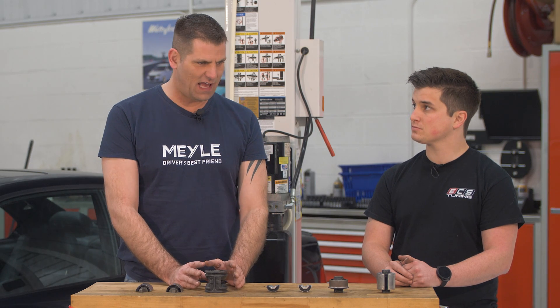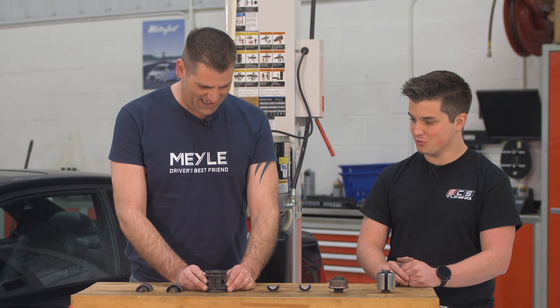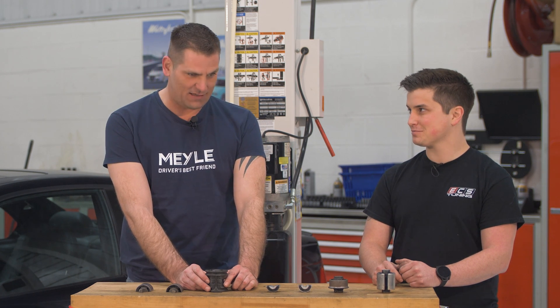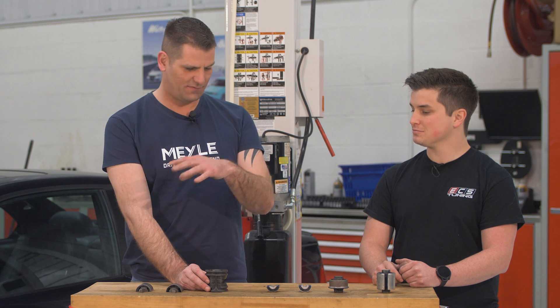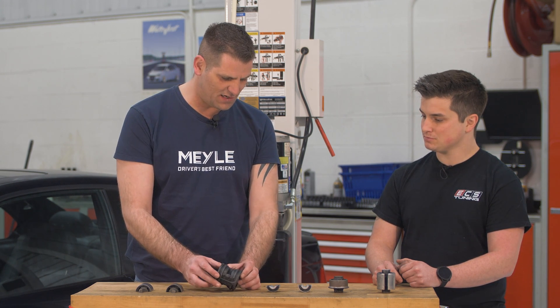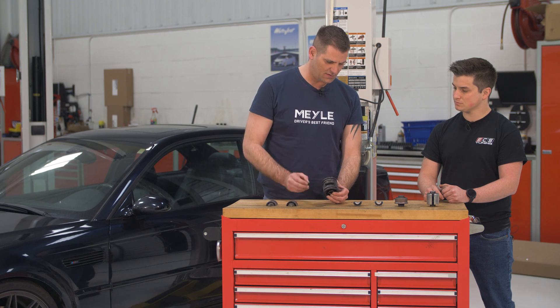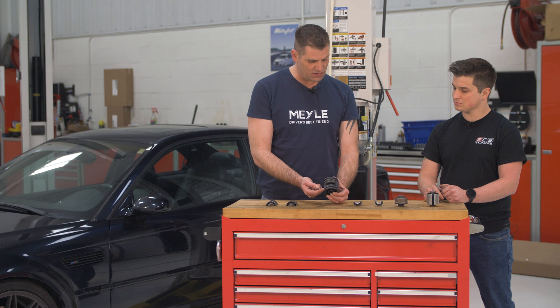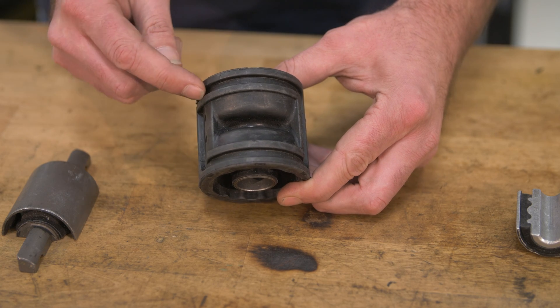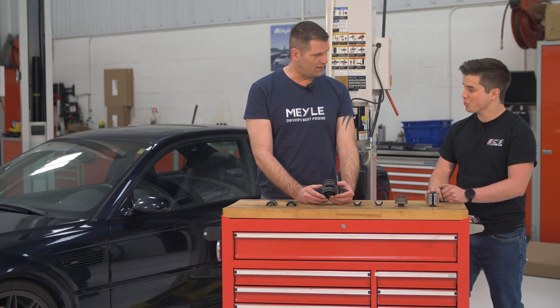One thing that came up on BMW — for example on the E39 the first time — is that people were always complaining about a shaking and pulsating in the brake pedal. Of course, most people replaced brake rotors and pads, thinking it was a warped rotor. But it took almost ages until people figured out there's nothing to do with the brake — it's actually a bushing that leads to that failure. The reason is that on that particular car was the first time BMW used hydro bushings. Without the outer ring you can see all these channels, which are filled with a liquid — a blue coolant, because of antifreeze during winter time so the liquid doesn't freeze.